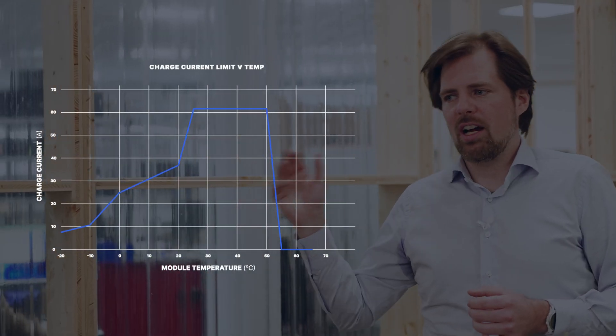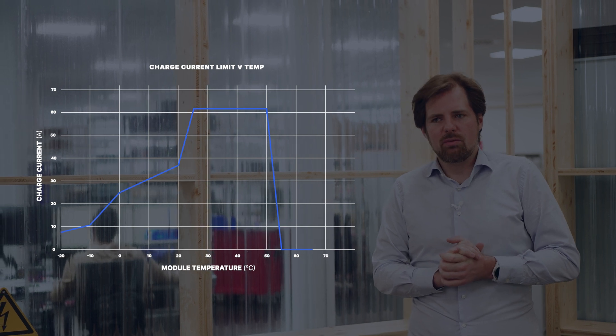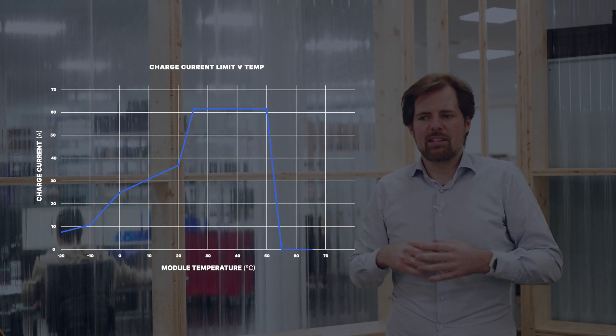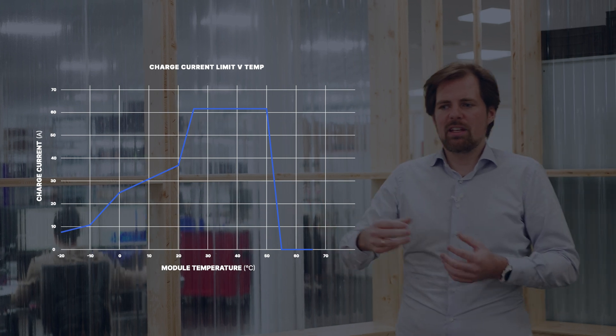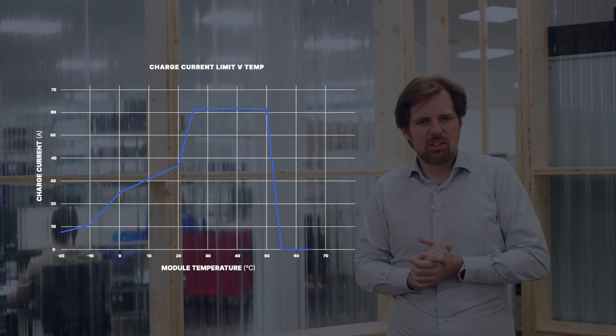The other important aspect of temperature is that the charge acceptance of a battery cell depends a lot on temperature. When it's very cold, a cold battery cell is not able to be charged very quickly. As you can see on this graph, the charge current limit depends a lot on temperature. The anode, which has to accept the lithium ions in the process of charging, can't intercalate those ions very well at cold temperatures. As a consequence, an effect called lithium plating occurs, where the ions are not going into the anode — instead they are absorbed outside, and that can lead to cell deterioration. Therefore, when you drive your electric car to a charge station, there's a feature that lets you precondition it for fast charging, which manages the temperature of the battery cell so it needs to be in the right range to charge.